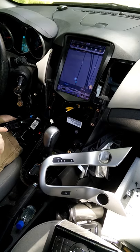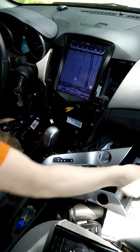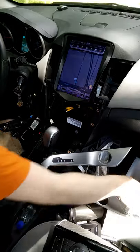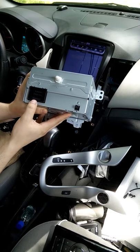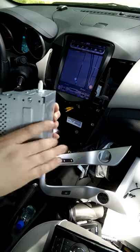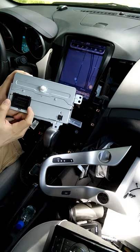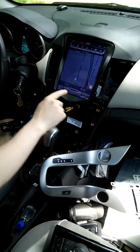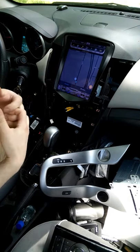I think the display just fit right up here and pops away after you remove the lower section with the CD player and amplifier — whatever electronics are in there. That opens things up. On the back of the stereo unit you'll have a connector for your factory wiring harness and a connector for your antenna. Just disconnect those. That connection has a camming lever that, when you move it, helps decouple it — it locks it in place otherwise. There's also a wiring harness included with the stereo that mimics the factory connector type so they also interlock.